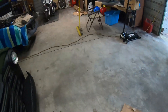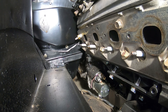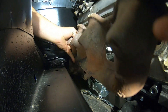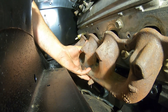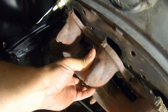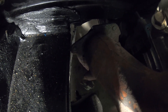I was originally wanting to use my original headers — let me show you what I got going on. I don't know if you're going to be able to see through the camera or not, but these are the original 6.0 LQ4 headers. That's where I was hoping to fit them up, but that right there is as close as I can get. You can see the gaps — the collector end flange right there is hitting the subframe.